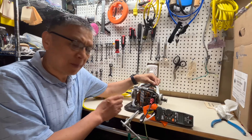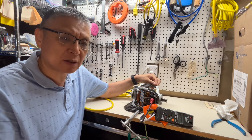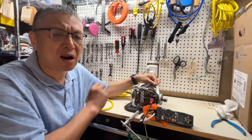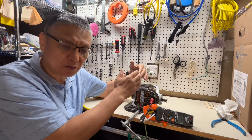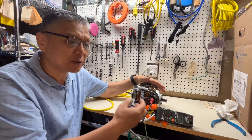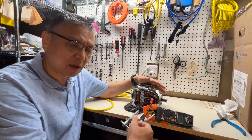When you run your dryer, you might experience that after around 20 minutes it will stop, but after cooling down — waiting a few hours — you can start it and run again. These symptoms most likely mean the dryer motor is drawing more current than the rated current, so the thermal protector inside the motor trips. After it cools down it closes and you can run again. This is either the motor failing or there is something causing more resistance, such as an obstruction in the circulation fan. I once had a case where a sock was stuck in the circulation fan and caused this to happen.